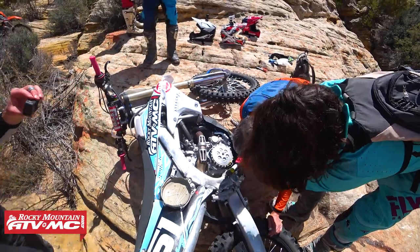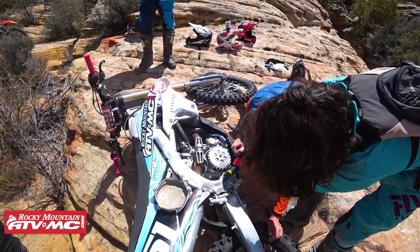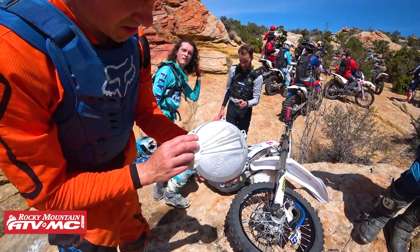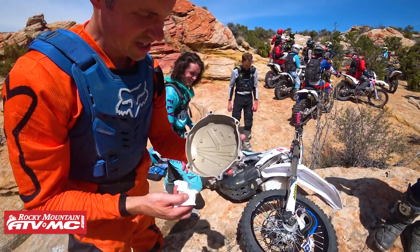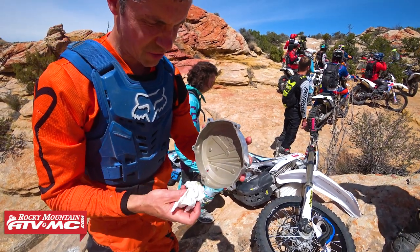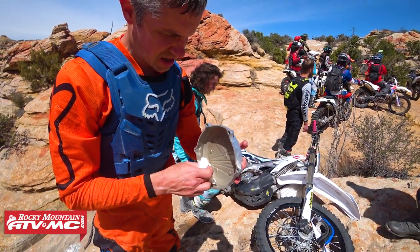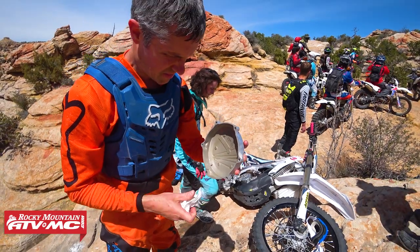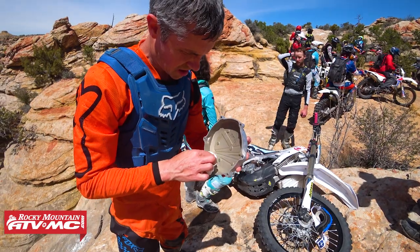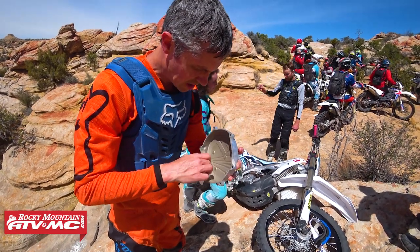We'll look for a minute, but it's probably just going to have to get chewed up in there and get caught in the oil filter and screen. Step one: PD's going to break out his first aid kit and give us some alcohol pads to dry up as much oil as we can before we stick the QuikSteel on it. You want it super clean — we might even want to scuff it up a little bit to give the epoxy something to hold on to.